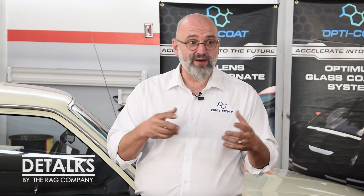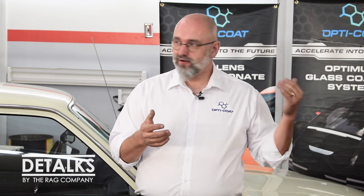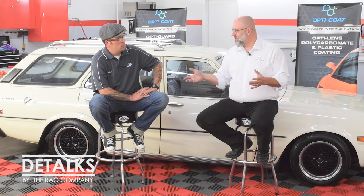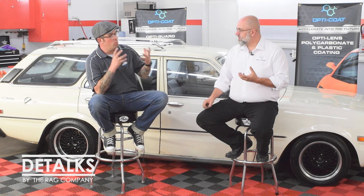And unfortunately, some compounds contain some odd solvents. A lot of companies say their compound is water-based. Water-based just means that it has more water than anything else. So if it has 50% water, 5% abrasives, and 45% oil, guess what? It's water-based legally. So water-based is more a marketing term than anything else. They all have oils, but some of them have solvents. And those solvents actually act like Botox. They kind of swell the paint up a little more, or plump it up a little bit.